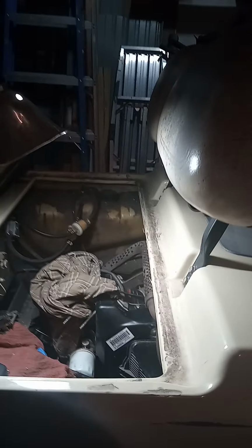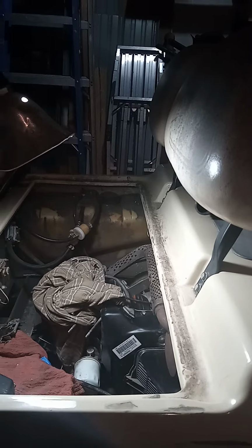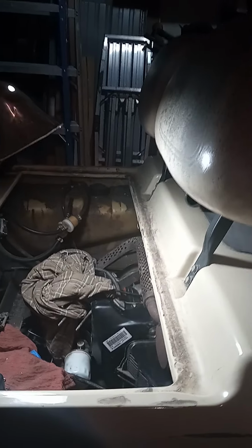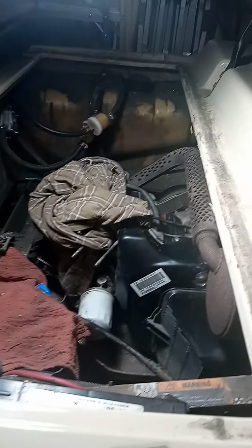I've got a 2000 Club Car here. I started having trouble with it about a year ago. It started running kind of funny, cutting in and out, misfiring. It seemed to be okay when it was under full throttle. After a while, it would crank over and crank and just wouldn't fire anymore. So I started with the easy stuff. Put a new fuel pump on it. Cleaned the carburetor.